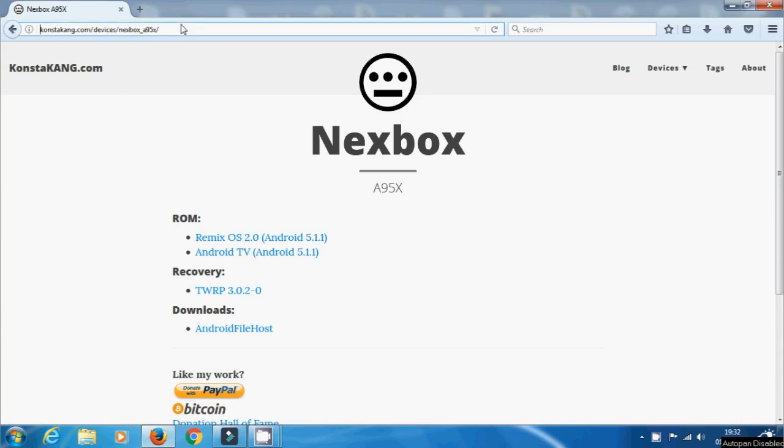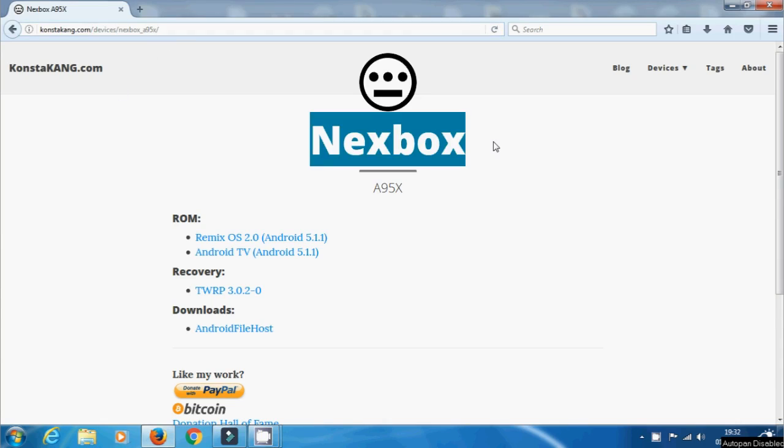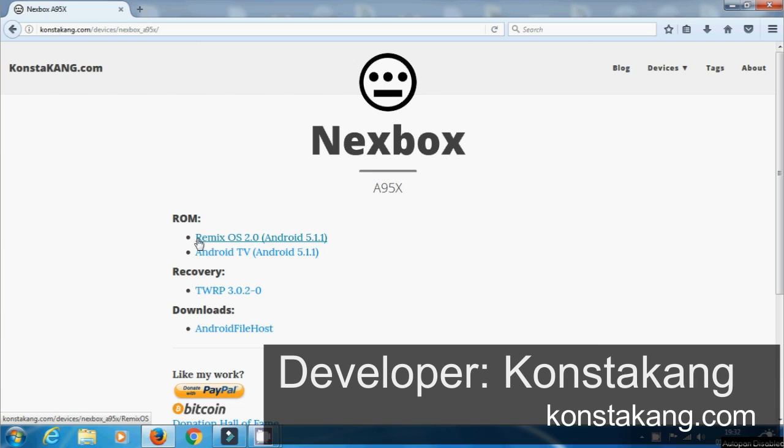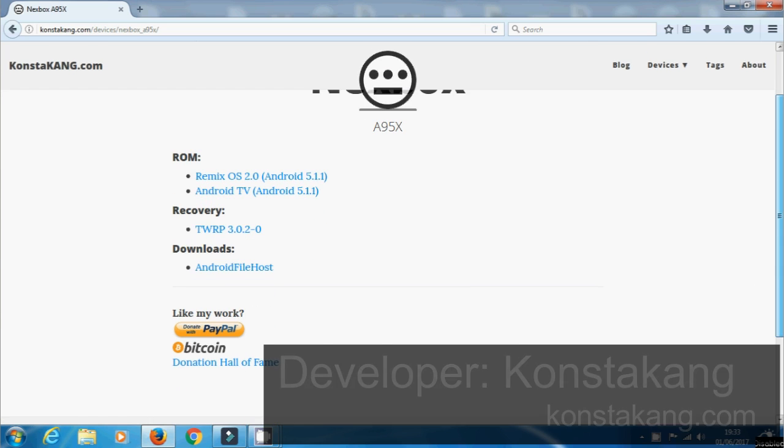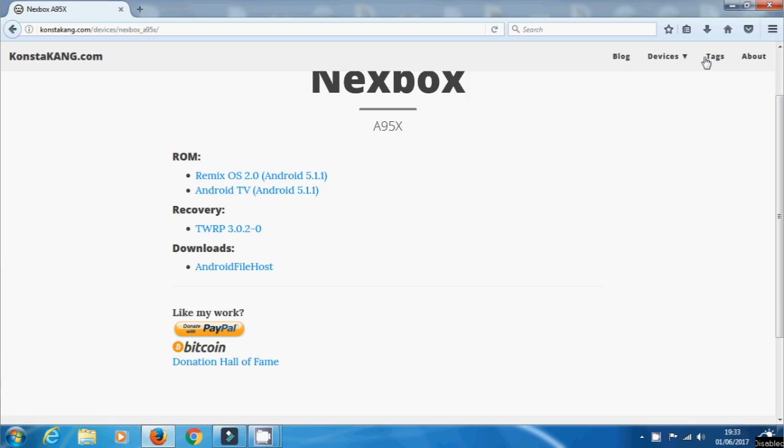So I remembered that the guy who builds TWRP for the S905, which is the NEXBOX device, his ROM was the one that worked for me. And I'll leave the link in the description to where you can get that firmware. Again, it's just a zip file, do exactly the same, place it onto the SD card along with a recovery.image, boot it and just follow the guide exactly the same. If that doesn't work, then you can try all the different variations of the Remix S905 firmware that's available on the Jide website. So that's it for this video.